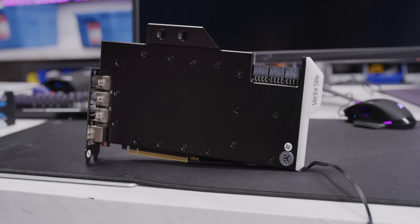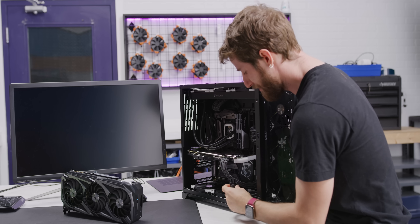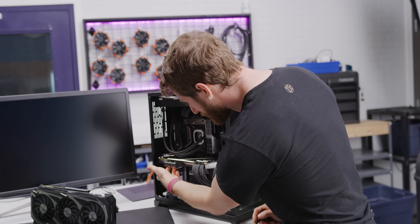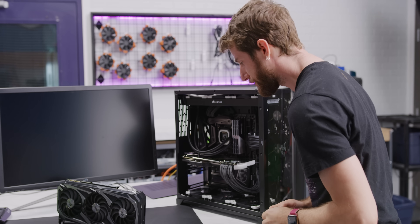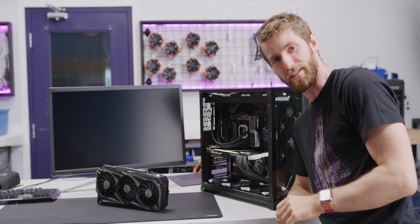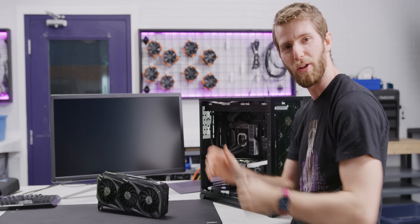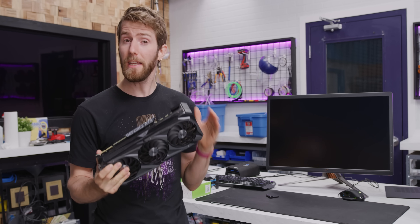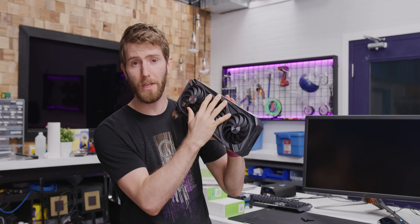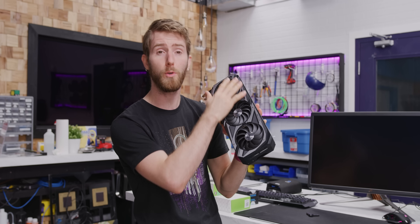This is as simple as firing it up and getting going. We're going to need three 8-pin PCI Express connectors. We'll throw some fittings on and build the dirtiest-looking water cooling loop you ever did see — not literally dirty, it'll have clean water, but gut-spilling-all-over-the-table style. NVIDIA's last few generations of graphics cards thermal throttle at about 80 degrees so effectively that you can't really use temperatures alone to determine if a cooling solution is adequate.